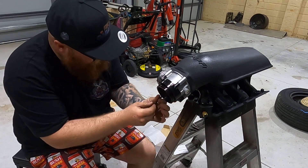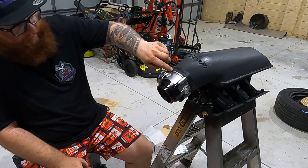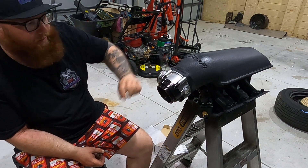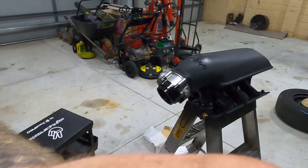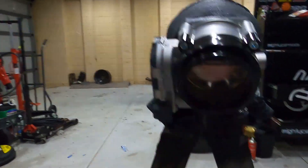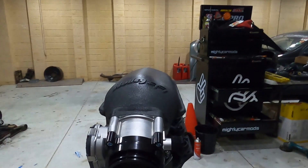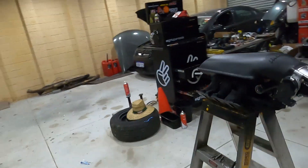Alright, that's on. I'm not going to bother nipping it up because I've got some painting to do. You can see little bits around there that are still silver, so I might spray that black. I'll mask all this up and spray that black as well so it's all nice and hidden. The throttle body does look small compared to the plenum, but I really have no need for one of those big 102mm ones - this is more than big enough. Now I've got that sorted, I'm going to move on to the injectors.